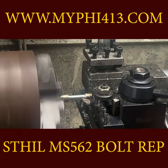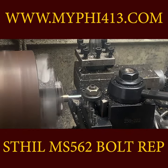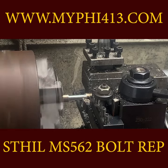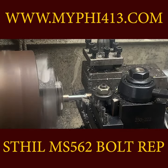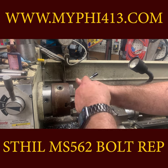Don't go all the way through the case wall. Going through the case wall doesn't really matter because there's no oil in a two-stroke motor, but you must be careful you don't go too far as you could cause the crank or something else inside to make contact with the bolt.